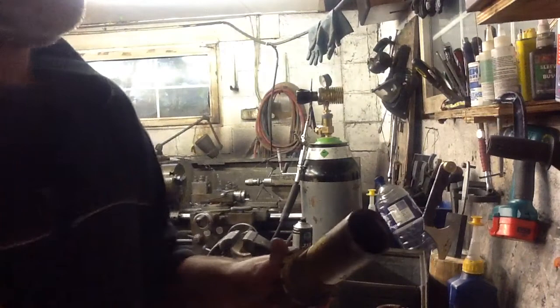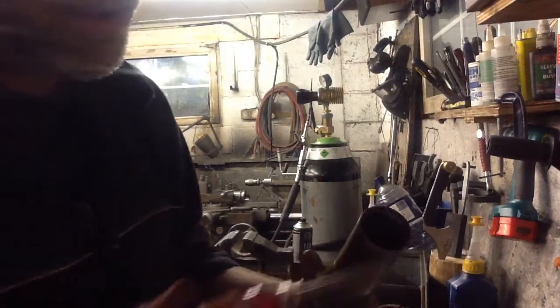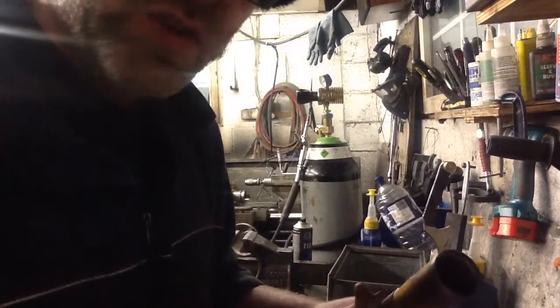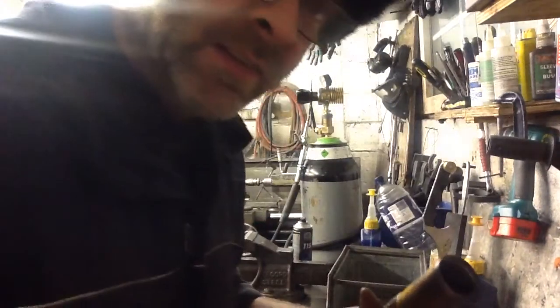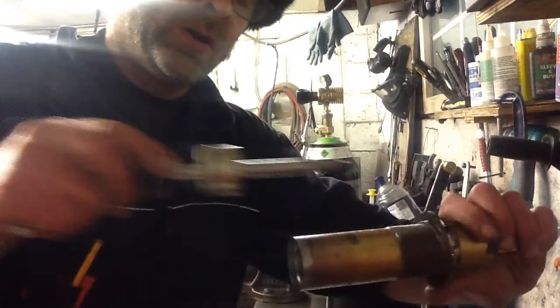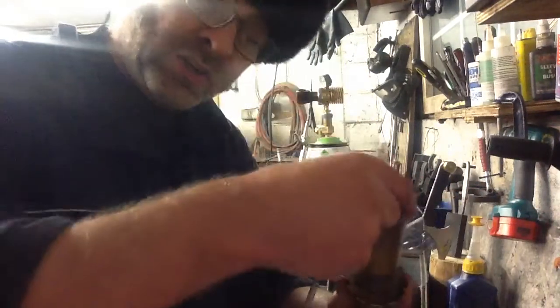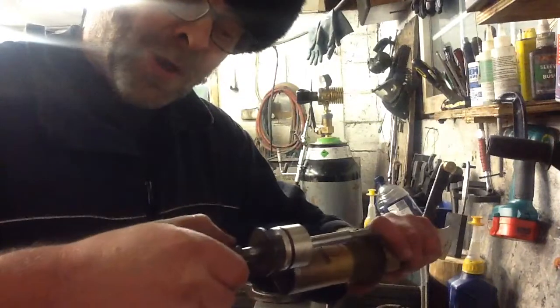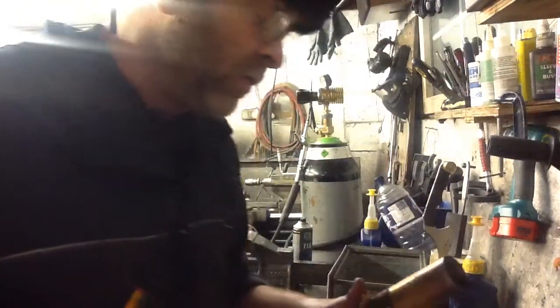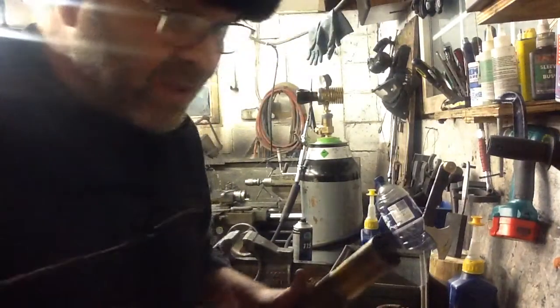Basically, on average, what you will have in a shock is a groove in here to which a circlip fits. Okay, now the block goes into the shock, you then put in your circlip, which stops the block coming out when the shock is under pressure from either use or nitrogen, right? That's the principle. Now,